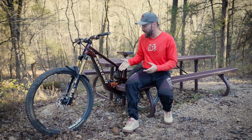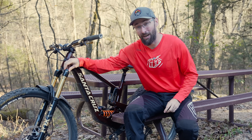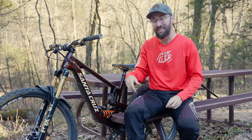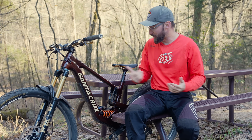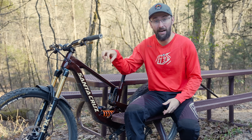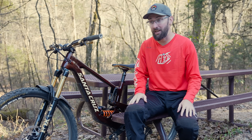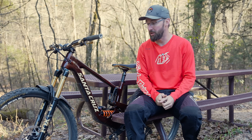And with Fox, I mean, I barely had to do anything. I was prepared, man. I brought a socket to take off the air cap for the volume tokens. I brought a shock pump. I was gonna do whatever it took to dial this in, but all I had to do was just back off the compression like they recommended. And I only went in one direction, and it feels really, really good now.